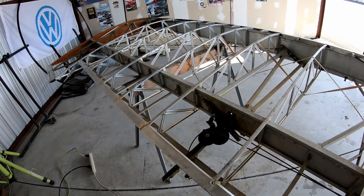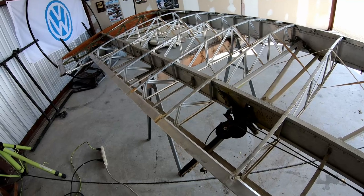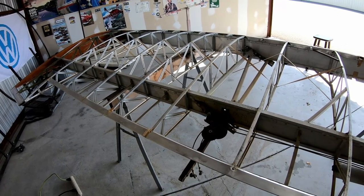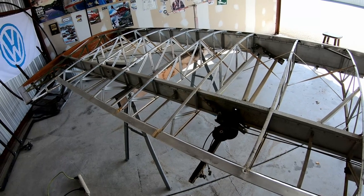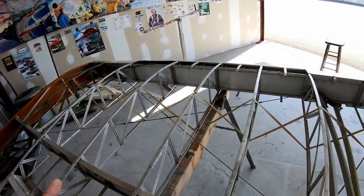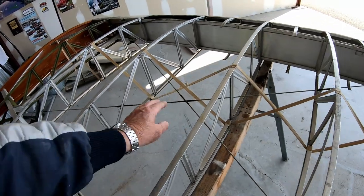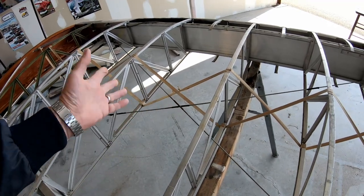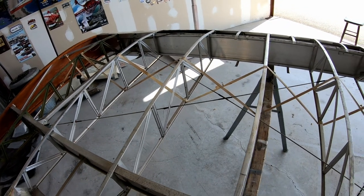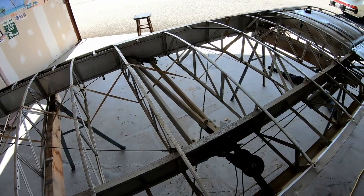Then I'll take everything - all the fittings - home. By then hopefully the fuel tank will be welded up, so I can prime and paint that too, and put the fittings back on. After that I can do the final touch-ups on the wing. I need to square it up since I took the brace wires off - I want to make sure it's still square. Right now I only took one set of brace wires out where the tank was, but I also have to loosen the other set. Then I have all the brace wires off and I'm getting close to actually recovering this thing.